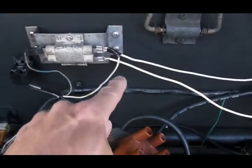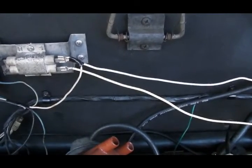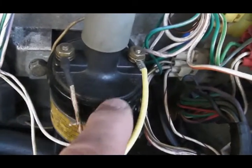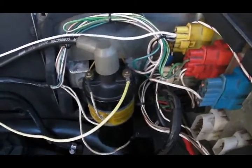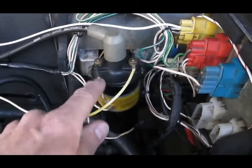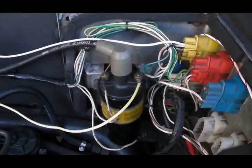From the resistor grid, you have a white with yellow wire - I'm using just a plain yellow wire, but in the factory wiring harness it's white with a yellow stripe. And it runs back to the positive terminal on the coil. There's a plus sign on the positive terminal, so you have to put the white with yellow wire on the positive terminal, not the negative terminal. Then the negative terminal, which has a little negative sign on it, goes back to the ignition module. This wire is white with a gray or slate stripe - you have to look closely, but there is a stripe on that wire that's gray in color.